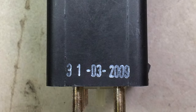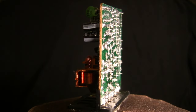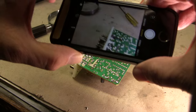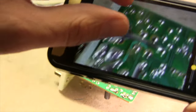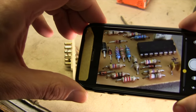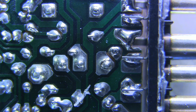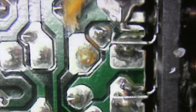I know this is a newer aftermarket relay by the date code stamped on the outside of the case. This other relay is from the six-cylinder engine — the through-board components have solder joints on the back, and that is where we should look first. There are often damaged solder joints that will cause a broken circuit. You don't need a magnifying glass — a great way to get a close-up look is to use the camera on your phone. Zoom in and systematically snap pictures to survey all the circuitry, looking for any cracked solder.